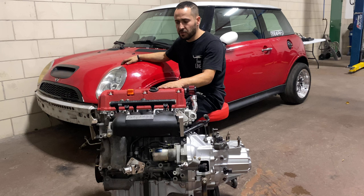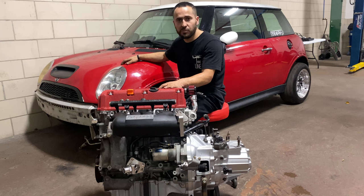I have here a TSX 2.4-liter engine. This is personal preference — I prefer the K24 due to the displacement and torque these motors provide. They're very affordable; you can pick one up from a JDM engine depot for about $900. There are slight changes you have to make to get it in. As for transmission, you have five-speed and six-speed options, with or without factory LSD, so you'll need to do your own research and decide what setup is best for you.